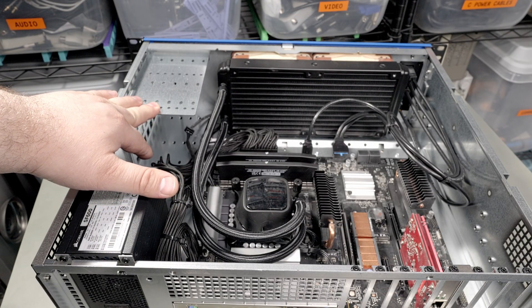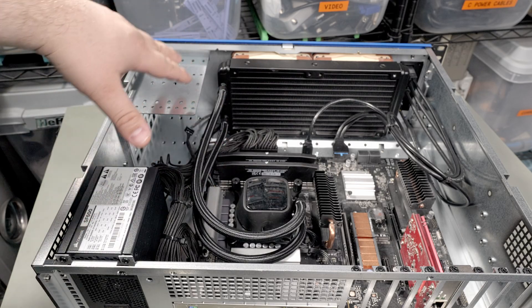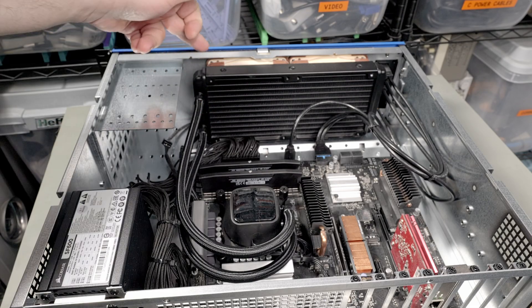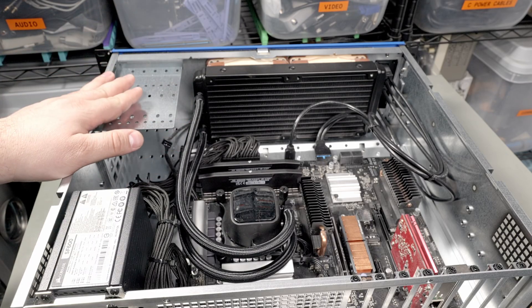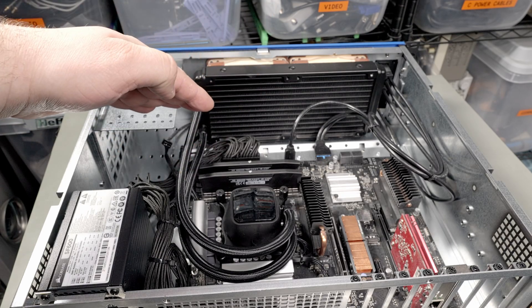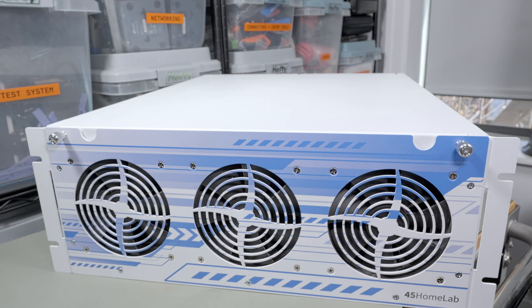My other concern with the HL15 is that there's not really any cooling on the hard drives due to their positioning. There's barely any vent at the front - the drives are in an enclosed space with almost no airflow. If you have 3.5 inch drives, they're going to run hot. If they maintained the same vents but moved the drive cage forward about 15mm, you could fit a thin 120mm fan and that would be fine. Overall though I really like the case - most of my complaints are just nitpicks for a version two. They're not cheap, in the $300 range.